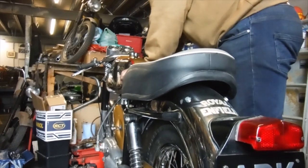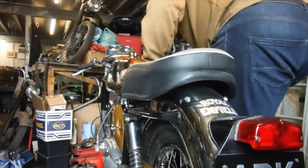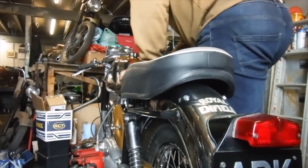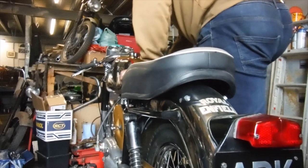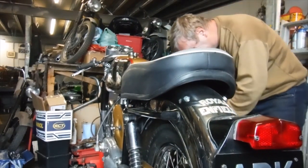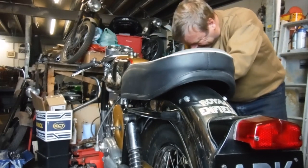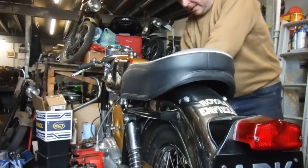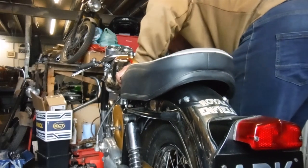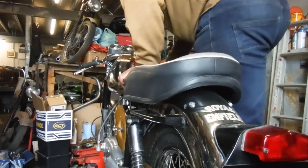The ammeter needle is moving when I turn it, so I know there's a spark, although I've seen the spark on the spark plug as well. I can't get my fingers over the intake. It's so close to the tool and battery box. I'd like to put my hand over it and make it sort of suck harder through the jets.